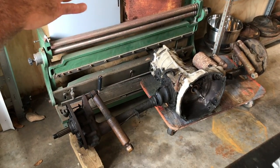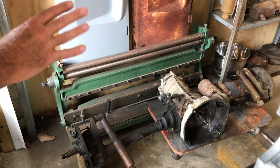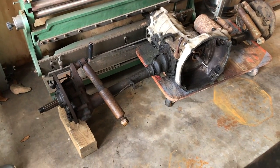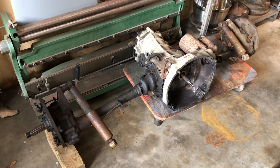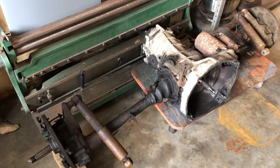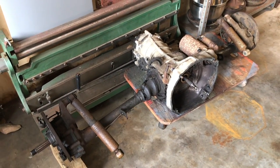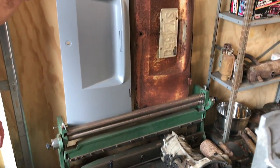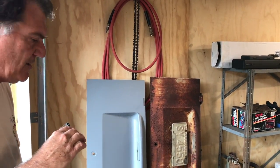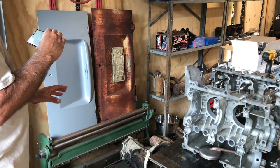That's when you see a lot of the 61 to 63 buses with cut out wheel wells — they were trying to get big tires under them to drive on the highway. My suggestion was to go with the big nut axles since he wants to keep the 40 horse original engine, and leave the 0.824 gear — that gives you the ability to drive it on the freeway while still having a low enough gear for the transmission to work well with the 40 horse.